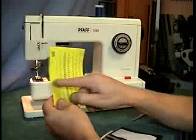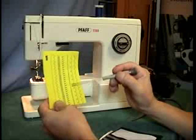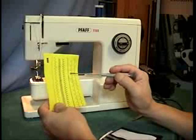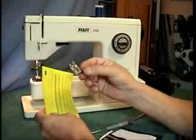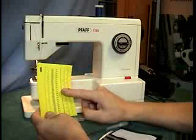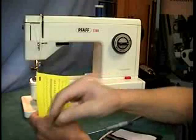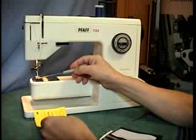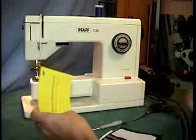I'm sure if I had her booklet there might be a few more. The one thing about the triple stitch: I've been trying to get them to come out pretty well. When you do this triple stitch, you need the little plastic foot — this is mine, I'm not selling it, I need it to repair machines. Normally when you do the triple stitch, you're going to want to use embroidery thread or something — it says in the manual to use the plastic foot, an embroidery thread, and a certain sized needle and it'll come out better. If you're running the machine on the regular foot, it should give you a stitch, it might not look great, but it should give you a somewhat okay stitch. If you want it better, then use the plastic foot.